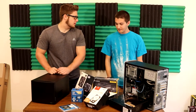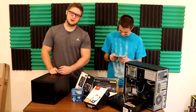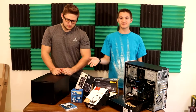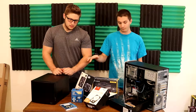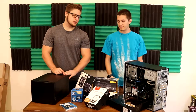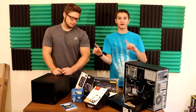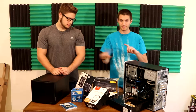Can you tell me the frequency of this RAM? I think it's 1600 megahertz, so it's DDR3. It's 16 gigs — two 8-gig DIMMs. I have four slots on this board so I could run two more. But 16 gigs should be more than enough. I've also got a program called Plex, which we'll get into in another episode — essentially I have movies and other stuff people can access, so I do need quite a bit of RAM for that.